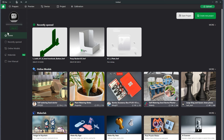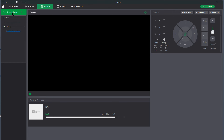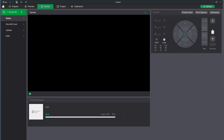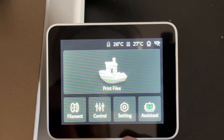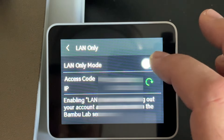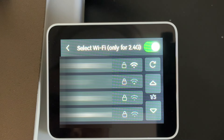Make sure you're logged in — you'll see a username — then go to Device and click on 'no printer.' How I went about it: first, make sure your internet connection's network band is at 2.4 GHz. Mine was — my WiFi extender is 2.4 GHz. Once you've ensured that, come in here, then go to the printer. Go to Settings, go down to LAN-only mode in case you turned it on, and turn it off.